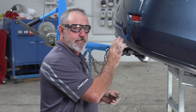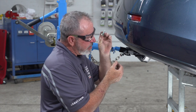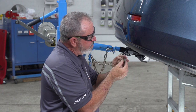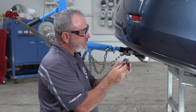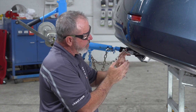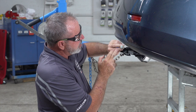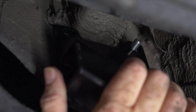Okay, we're here on the passenger side. We're going to take our provided hardware and place it through the existing holes and then through the hitch. To do that, I'm going to have to go right behind the fascia here — it's a pretty tight space, so I'm going to put the bolt between the tips of my two fingers, raise up, reach up, find the hole, and put it through.